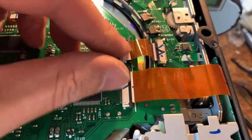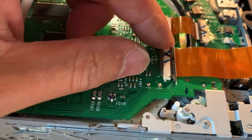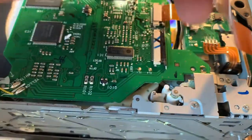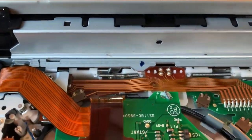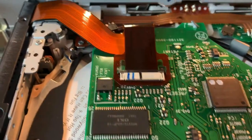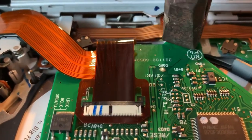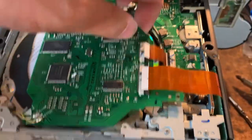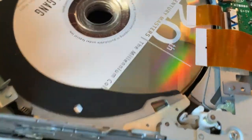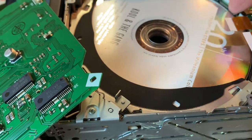The way to remove these ribbon cables is to just pull up on the black tab here like this, slide the black tab towards the cable, and then it just loosens up and you pull the cables out. The screw is very easy — make sure you get the right size screwdriver. For that tang, all you do is use a pair of pliers and just bend it in the direction of the opening. Same thing with the other tang. Then you should just be able to wiggle and slide that board out.